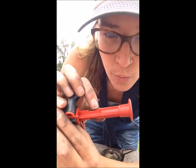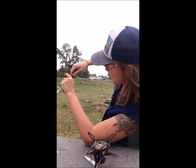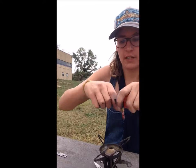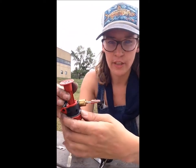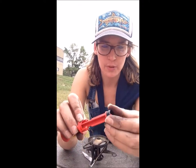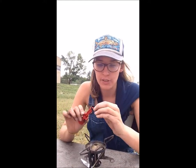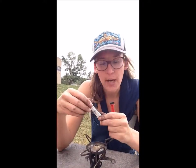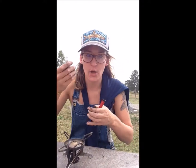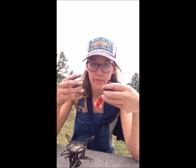There are directions on here — it says one, two, and three. What you do is you align it first, push it to a really tricky little spot, play with it, and find the spot where the one arrow meets the end. Then you turn it and it clicks over, and once it clicks you pull it out. Here's my O-ring right here. If this gets ruined, this is probably what's gonna get ruined the most — these stoves are pretty indestructible otherwise. This O-ring is what you're gonna need to replace, which is really easy because you can just take it right off. This is pump cup oil, and you can put a dab of this on your O-ring just to keep it lubricated, which will be healthy for the stove.